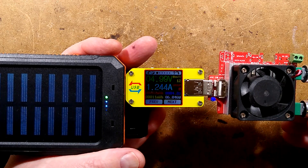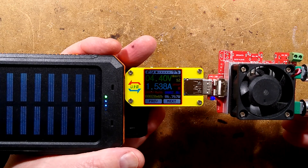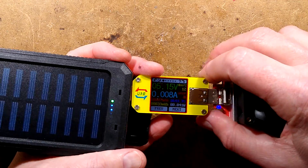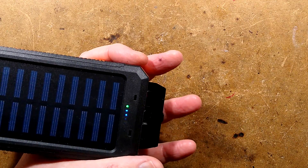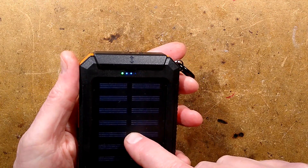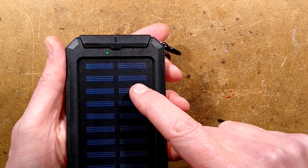As we go to 1.5 amps, it starts to drop quite dramatically - it has actually dropped down to 4.4 volts. Let's see if we can get the full two amps output. It conked out. It's a small compromise for the fabulous capacity of this 9 million milliamp hour cell. The listing shows wall-to-wall solar panel sections, but this is skimpy. I'd put this at about 50 milliamps output - that's going to be decades before it's charged off the solar panel.